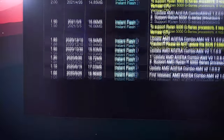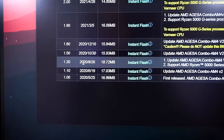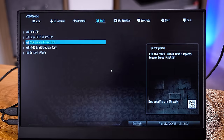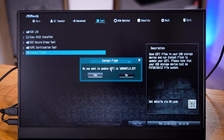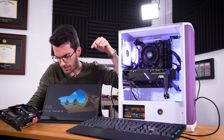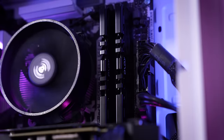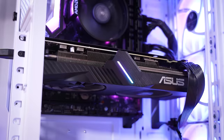According to the product page, P1.20 was released back in 2020 — so yeah, we need to upgrade this. We've got the ROM loaded onto this thumb drive. Swinging over to Instant Flash — yep, that's what we want. We'll click yes, make sure we don't power off during this process, don't touch anything, and don't do this during a lightning storm — ask me how I know. A few minutes later and we've loaded straight back into Windows with the BIOS updated. We should have more stability in the long run, especially memory stability, with more recent BIOS updates on the AMD side.